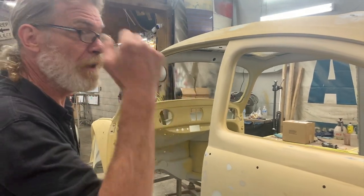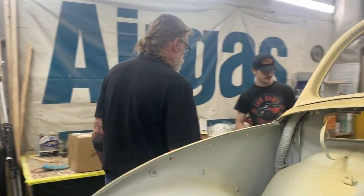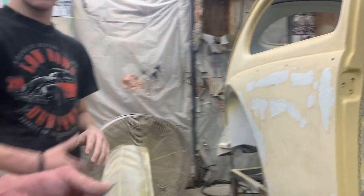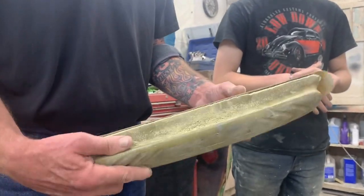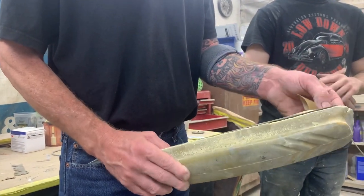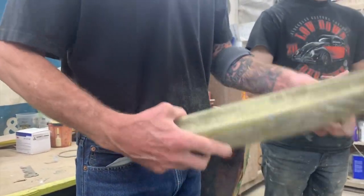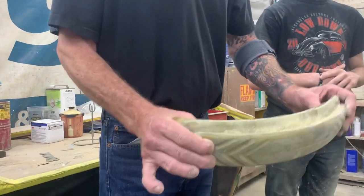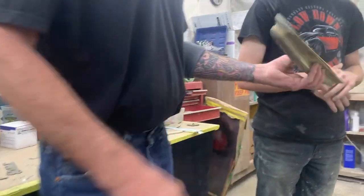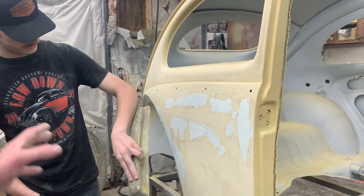All right. So when you want to grab the long block, we'll come over to the other side. This is working on that side. Go ahead and show people what we're working with first. This is a generic one. I think this was Harbor Freight maybe 10 years ago. It's inexpensive. I've had to glue the backing in a couple times, but it's actually got a steel plate in it. Some of them have rods in it to increase and decrease tension, but the nice thing about this, it flexes and goes back to itself. So by doing that, you're actually able to cover more of a surface panel.